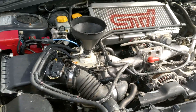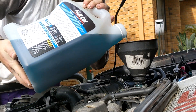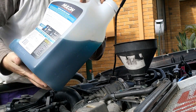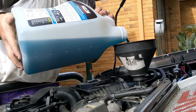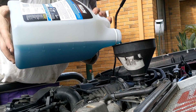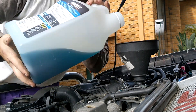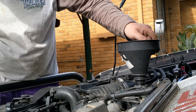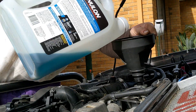After filling it up and going for a drive, I realized my top hose decided it wanted to leak, so I need to get a new clamp for it. But overall it seems to be about five degrees colder than the stock radiator, and when you give it some it stays relatively good around the 90 degree mark and comes down quite quickly. So yeah, that's about all.